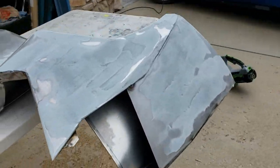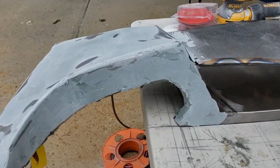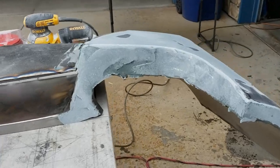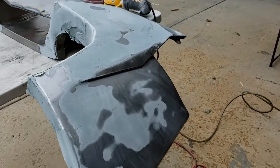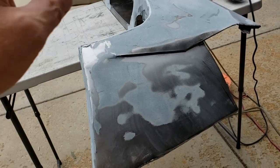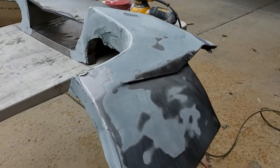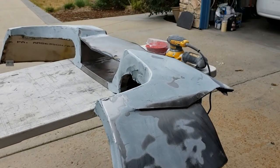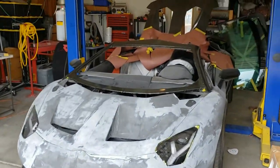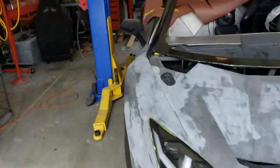The other thing I've done is worked on the roof section — I've welded it all together. It's a nice stable structure, nice and strong, and now we're doing some of the bodywork on it, trying to get the shapes on one side looking like the shapes on the other side, keeping it all nice and symmetric, and then getting it nice and smooth before we put a layer of carbon fiber on it. It'll be of the same type of weave that we have there, but there are some other parts we're going to do something a little bit different on.